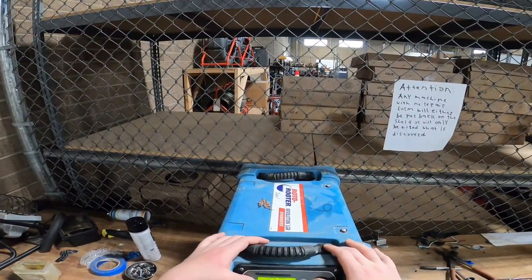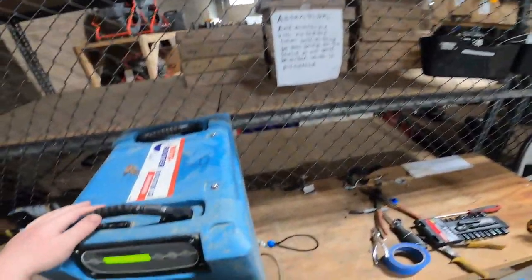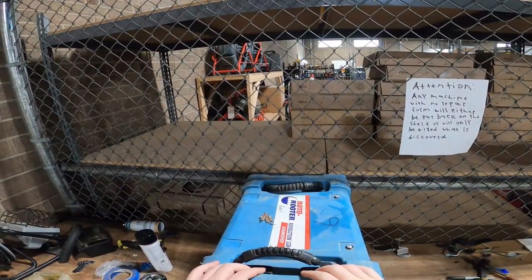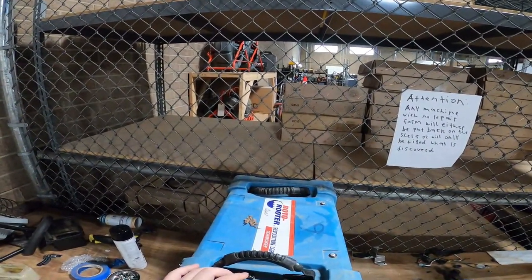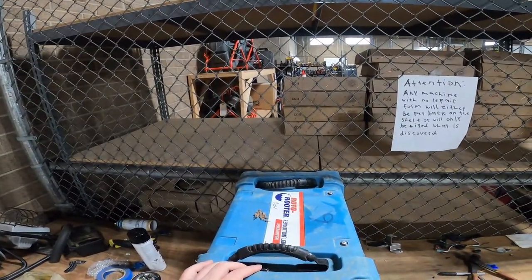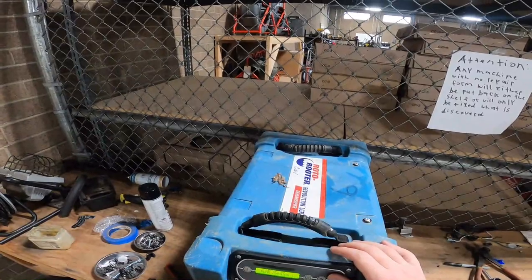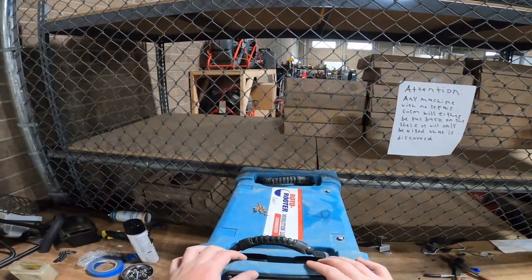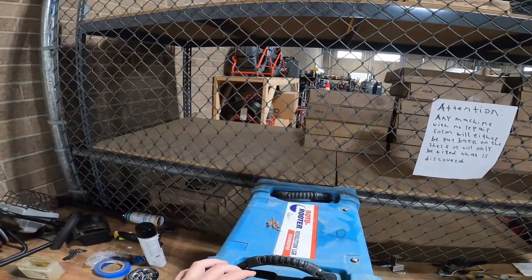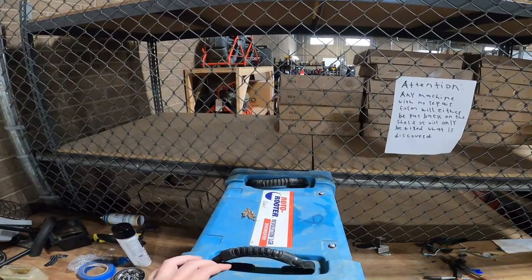Coils need to be cleaned. Uh-oh. So the compressor's not kicking on. I'm gonna give it a few more minutes just to make sure. It doesn't click on by the time the delay is done, and that means there's something wrong with the board. Oh, there it goes. Okay, so we're gonna run it.